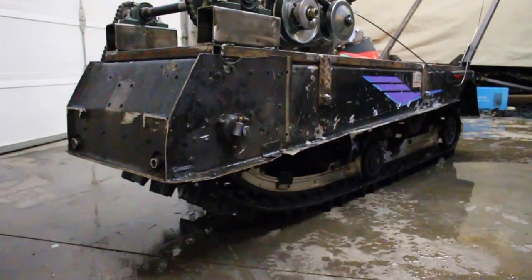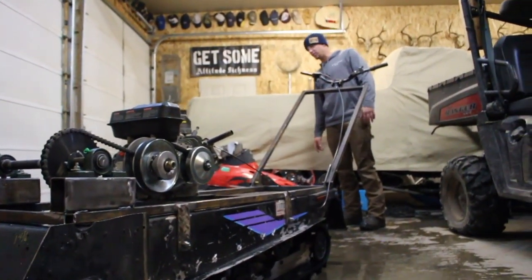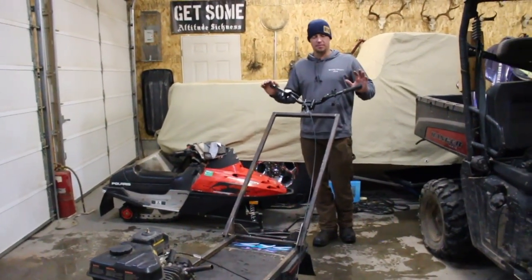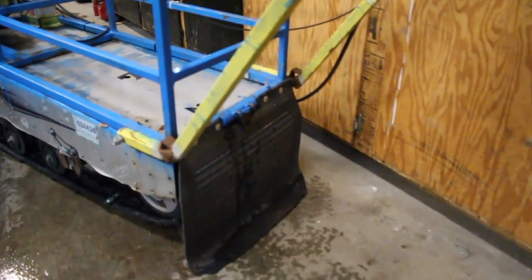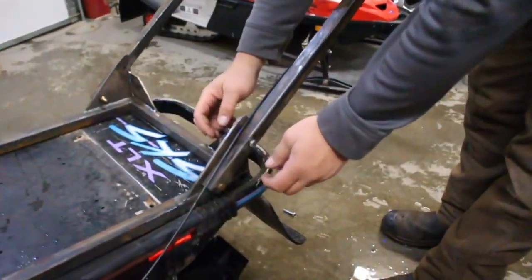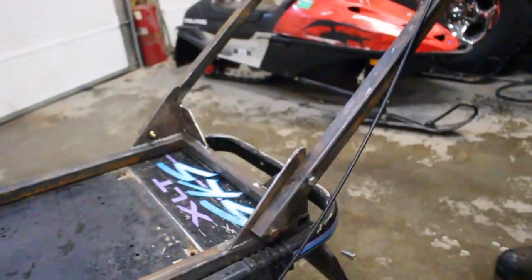About the only other thing besides the external chain case, centering the motor, and trying to make it so the tunnel doesn't buckle, is the bars. Instead of having the bars fold down and pivot to where you can just push down but can't push up, on Project XLT we pinned both sides right here. It's bolted here right now, but eventually it'll just be a pin that goes through there so you can pull the pin and pull them forward — they're pinned in place so you can push up or pull back.